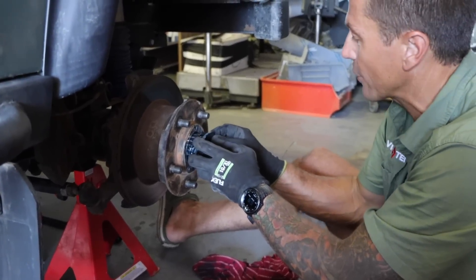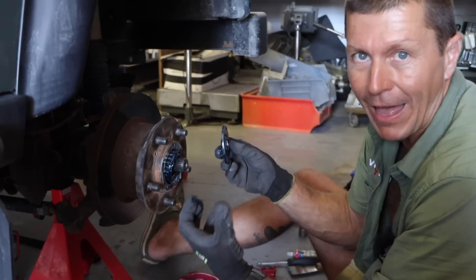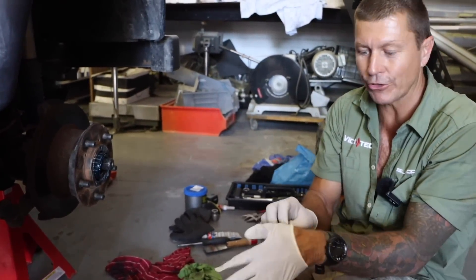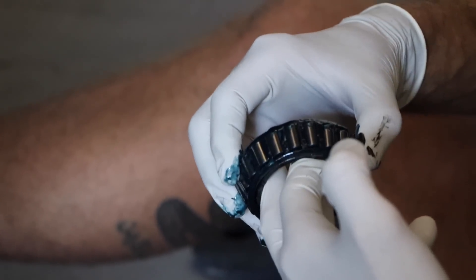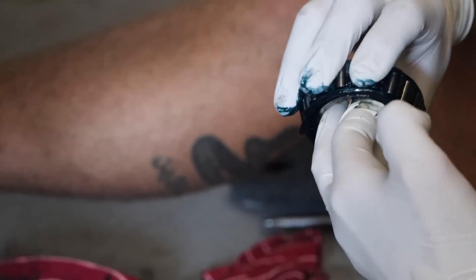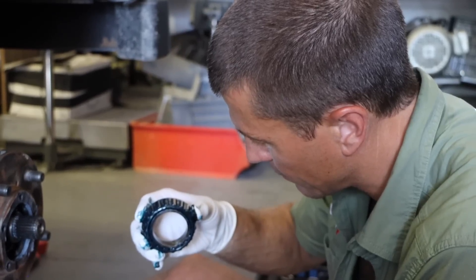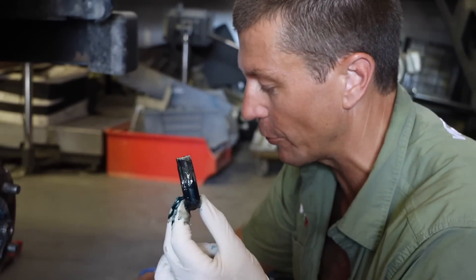The bearings are brand new essentially — they've done a couple of thousand kilometers. I am inspecting them, repacking them and cleaning them if I think they need it, but most have come out with the grease still looking clean and fully packed. I always carry a packet of surgical gloves. This one has had a little bit of heat on it — still seems in good condition but it's definitely cooked on the inside. It definitely needs repacking and a clean-up. That there is the spacer tube, or crush tube.